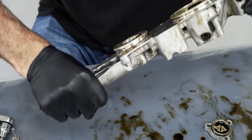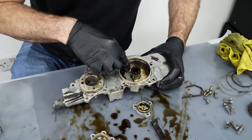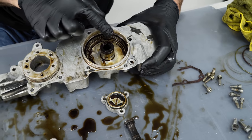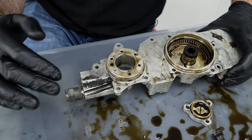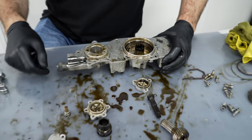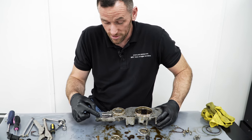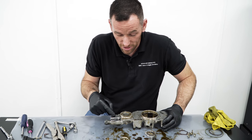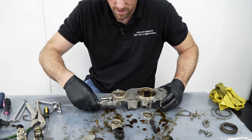So is this what regulates to the 120? Essentially, yeah. The oil pressure comes out of here, generated by the radial pump. It then flows through the unit, and this is preset by the factory, roughly 120 bar. It can be a bit less when you measure it. But that regulates the flow of oil through the unit. Any excess oil that's generated above that pressure is then bled off and it comes out of a hole here. Okay, that goes back into the engine.